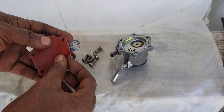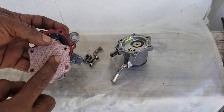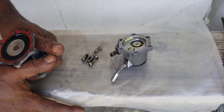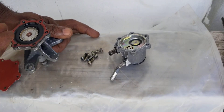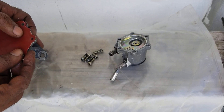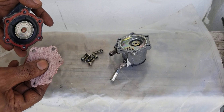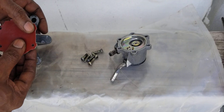What I want to do here now is apply some adhesive silicone on the back of this and bond it to this diaphragm. The diaphragm moves with a cam action — it goes up and down, back and forth — and that's the pump action for moving the fuel along the line. For this diaphragm patch to duplicate what the original is doing, we have to bond it firmly to this surface using adhesive silicone.